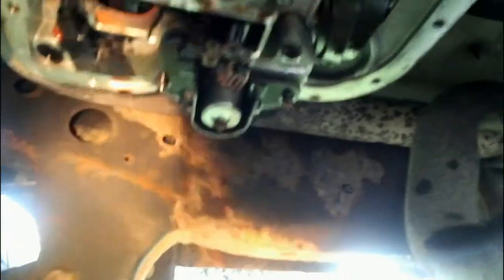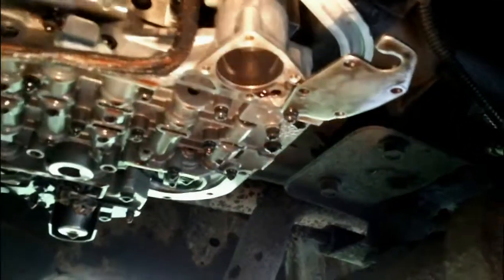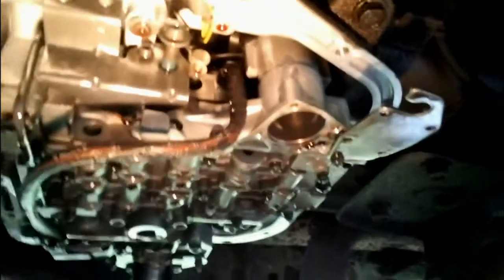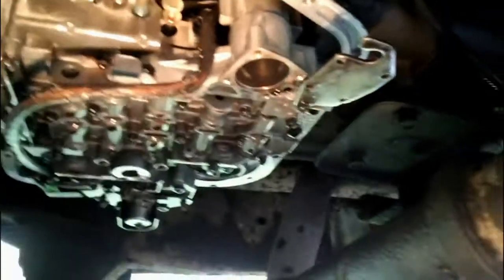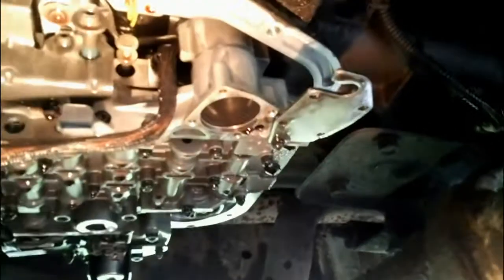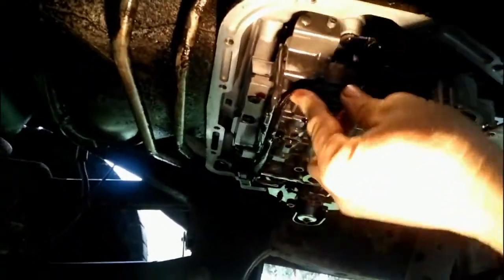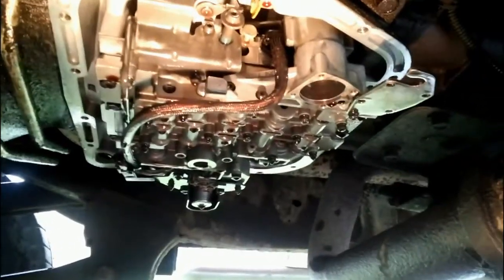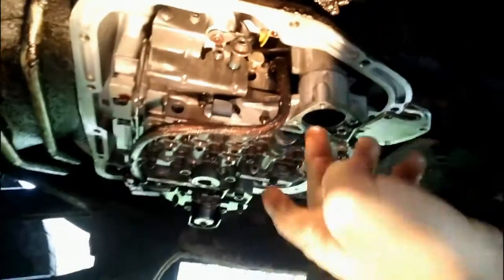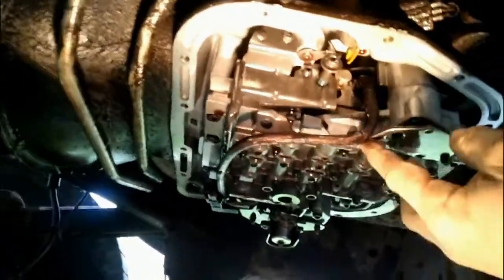This only applies if you do not have gears past second — if your transmission is not shifting beyond second gear. If your transmission still shifts beyond second but slips or does other things, it's probably not this. If it's slipping, more than likely it's your clutches or some other issues. But anytime a transmission like this all of a sudden just doesn't shift without ever slipping, it's usually something like this — a part just breaks.